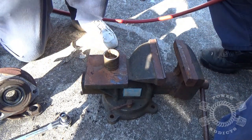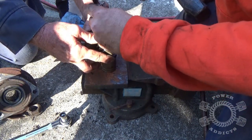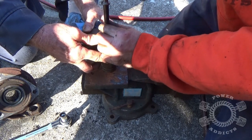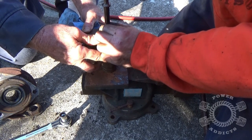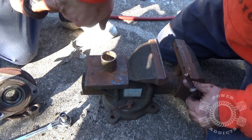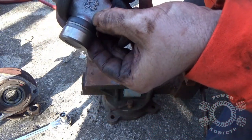We're going to do it the right way. My little homemade tool is more aggravating than it's worth, so we'll just use a socket and drive it through. See, she's sliding through pretty good right now. Stop before the cap comes all the way through — we brought it down just a little bit to create a small gap here and bring the cross up.